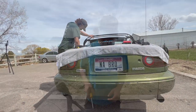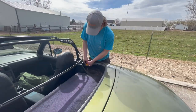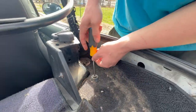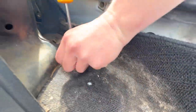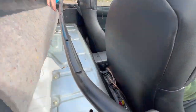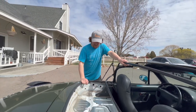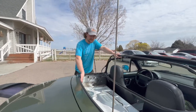Now that we've got the top material out of our way, we can get a better angle of access onto these little stoppers here. You don't necessarily need to do this unless you want to take the carpet out and clean it. Because of the leaky top, this one has been growing some cultures, so I definitely need to clean that. Now we'll give this a quick vacuum. We can leave the carpet out until we're ready to put it back in at the very end — it'll make it a little easier to get to the rain rail studs.